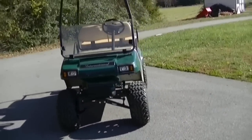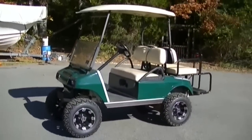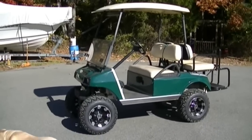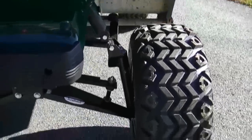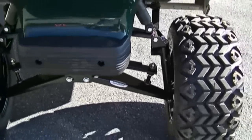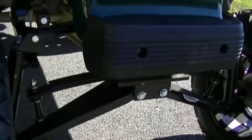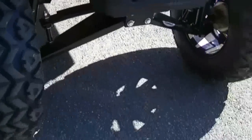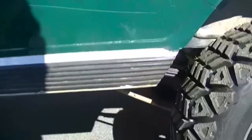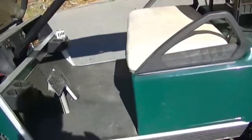Here's the finished product. Lift turned out really nice — wheels and tires turned out really nice. That 8 inches of lift gives it tremendous ground clearance. Got a little toe adjustment to do. Now I will tell you this about this lift: it rides a lot rougher than I thought it would. I'm hearing some people say to take that top spring out and I may do that. I started out with 8 inches of clearance and I probably have about 18 now. One thing to be aware of when you do an 8-inch lift is the brake cables — they're not long enough, so I have new brake cables on order.